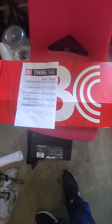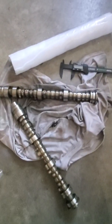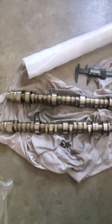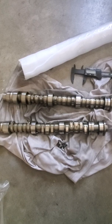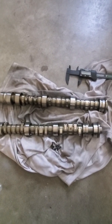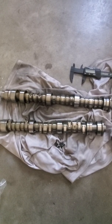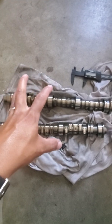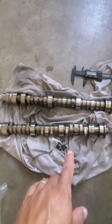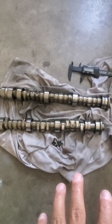Right here we have the OEM camshaft. The J37A1 is basically the same as the Type S — I would dare to say it's basically the same camshaft as the J32A3. I compared them and the difference is maybe 0.1 millimeter, maybe nothing. This one has a little bit more duration than the others, but the duration is around 160 to 150.